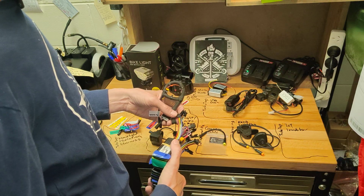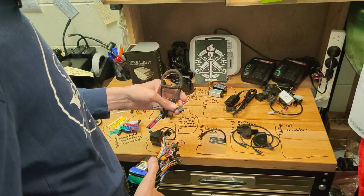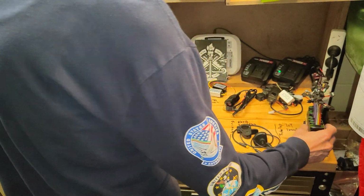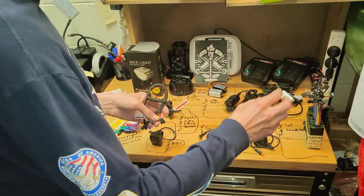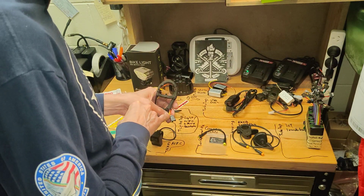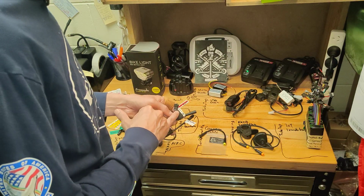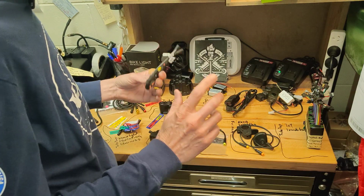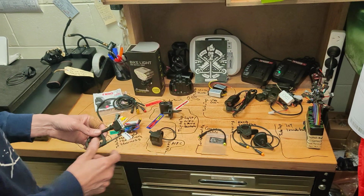And then the other 2 wires are, obviously, negative is black, and then there's a relay immobilizer. When the IoT tracker's relay immobilizer is turned on, it flows power through this wire, the yellow, I believe, and activates this relay. This relay then cuts the signal from the display throttle to the controller, so it will throw up an error, comms error, and there's no throttle.